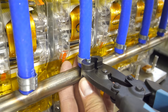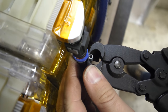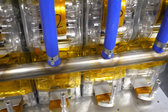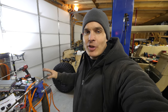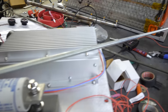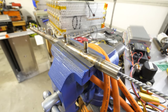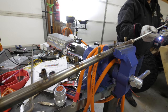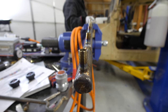The manifold is now populated and we can clip everything into place, just like little Legos. Since they're permanently clamped, they'll never vibrate loose no matter how extreme our off-roading gets. We welded this manifold with argon gas flowing through it, so there aren't many contaminants inside, but there are some burrs from drilling the holes. We're cleaning those out with a hone welded onto a bar of all-thread.